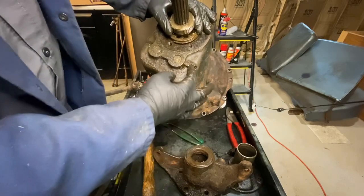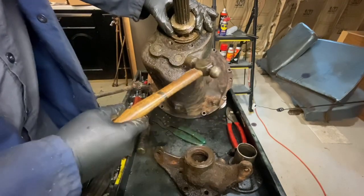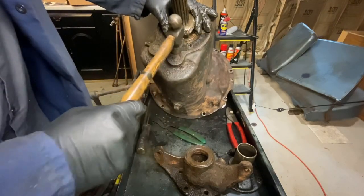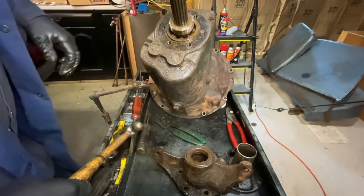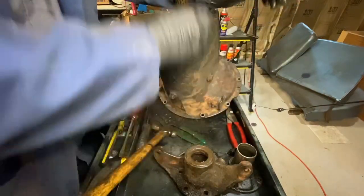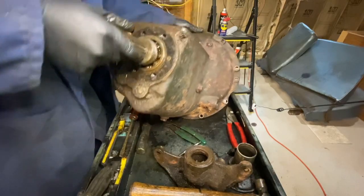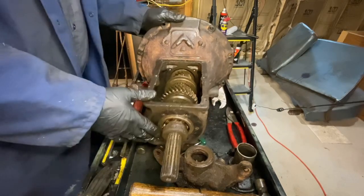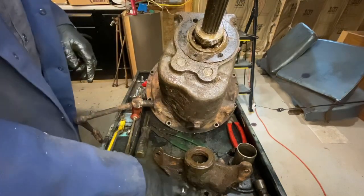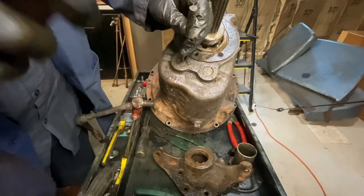There's supposed to be a cotter pin right here — take the cotter pin out, drive this to the side. This pin is holding these two countershaft gears at the bottom in, so let's get this out. Once these shafts are out both gears will drop lower down and we'll be able to get the input shaft out further. I get my parts from the Early Ford Store — check them out, I'm not sponsored by them, but they're pretty legit.